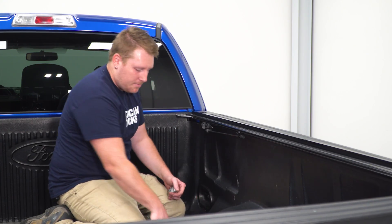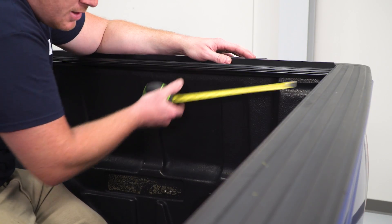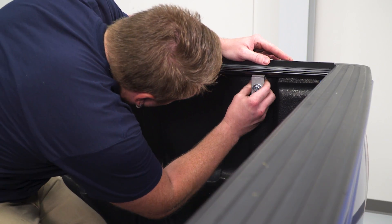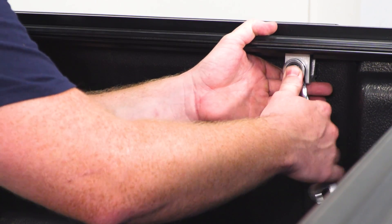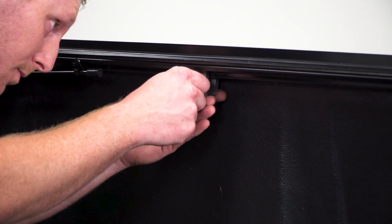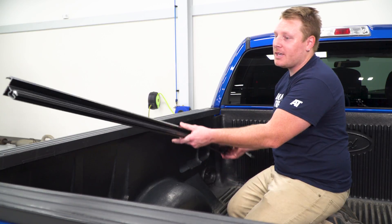After that, go to the back and do that clamp. For the rear one, measure about 6 to 9 inches back, then install that clamp — same thing, bolt head faces outward, and make sure they go all the way up and seat properly. Then go to about the middle of the rail and install your third clamp. After that, you can torque all three to 10 foot-pounds. Once you have that one side installed, start on the other side and do the same thing.